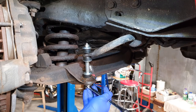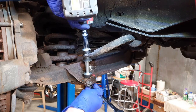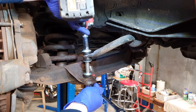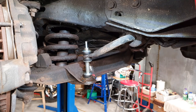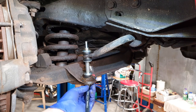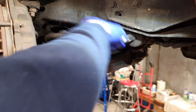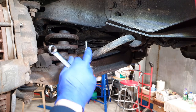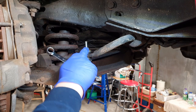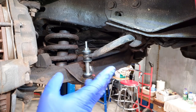Now we're ready to put the 14mm on there and do it up. You can see it will adjust itself. That feels tight — I'm going to double check that with two 14mm spanners, holding the bottom one. Yeah, that's tight, that's good. There's no specific torque for this, but it is definitely tight. They've also got little cuts in the metal that locate the nut properly. I'm happy with this side, so all I have to do now is exactly the same thing on the other side.